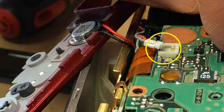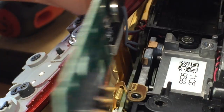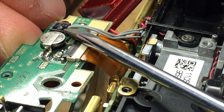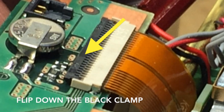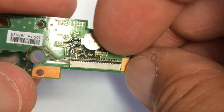Now we need to remove the connectors. This one's a power connector on top; I'll show how to remove that along with the one on the bottom. Then there's the big ribbon cable. Flipping over the board, there's another power connector — they operate the same and just need to be popped up. Then the ribbon cable needs to be removed in a special way: that little black clamp needs to be flicked out with your fingernail, and then the ribbon cable just falls right out.